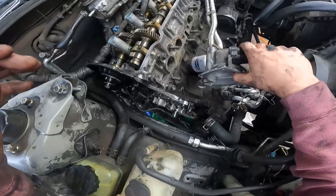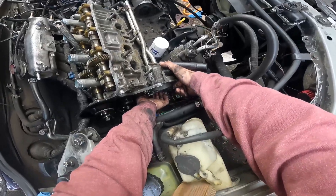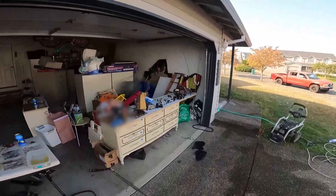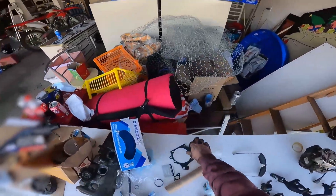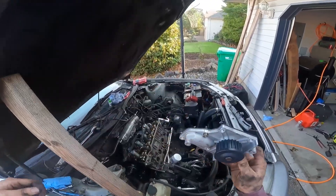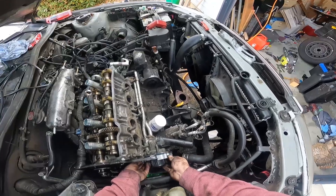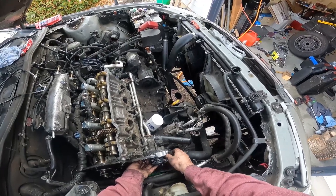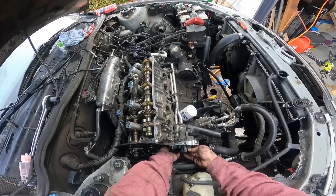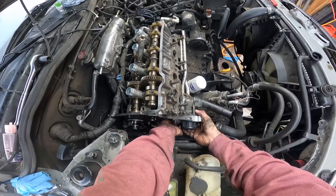Let's get this back into position. Make sure the O-ring didn't fall out — it's still in there. Then we'll grab our gasket for the water pump. I just stuck two bolts through the holes here to hold the gasket on and keep it lined up. Now it's time to get this water pump started on here, which is going to be a little tricky to line up these upper holes. The one that goes through where that O-ring is and then threads into the block behind it — that's going to be the tricky one.